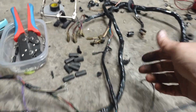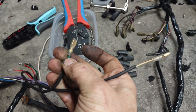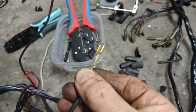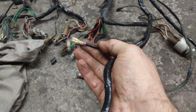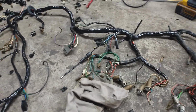Terminals are all good. Obviously, a few repairs, temperature, and oil. Got new gold crimped terminals, obviously with the correct tools, and even the ground for the one on there's a ground terminal on the firewall next to the battery where it goes down to the starter. New plug for the new starter. Still got to clean some of this up, relabel it.